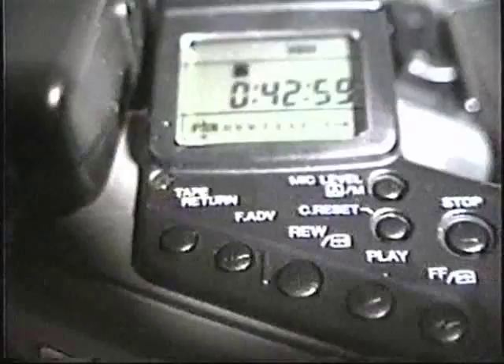And this has, of course, a real-time counter — which is not really a real-time counter. This does record hours, minutes, and seconds, but it even does this on blank tape. So it does not really read control track pulses — it just reads tape. That's something Rod Woodcock told me about a long time ago. And this has the usual things: a double arrow backwards, a single arrow forward and play. And if you scan, this thing blinks. This thing up here says that you are in fact in Hi-8, because I do have a Hi-8 tape in here. I put the thing in stop and the microphone level stopped, which is common to most camcorders.